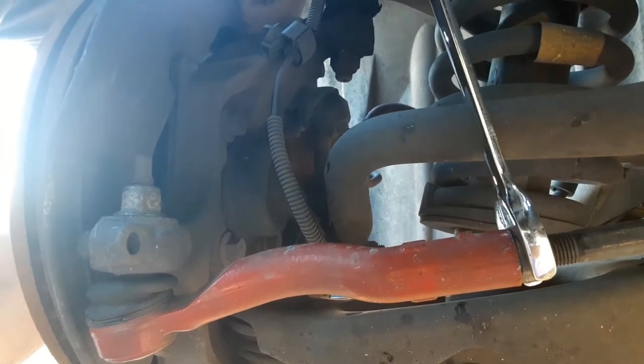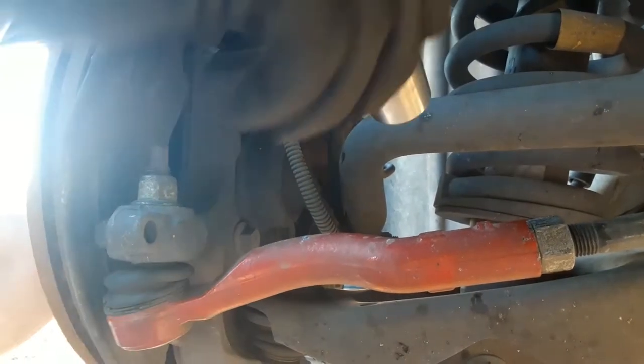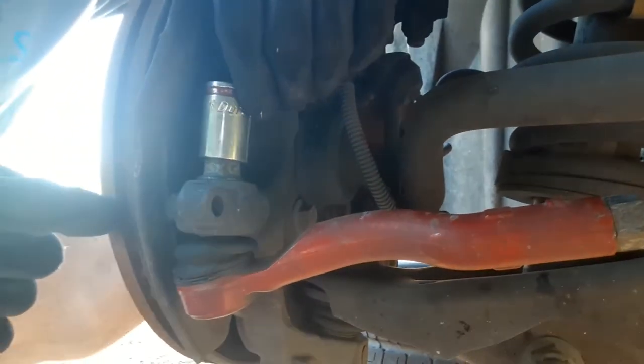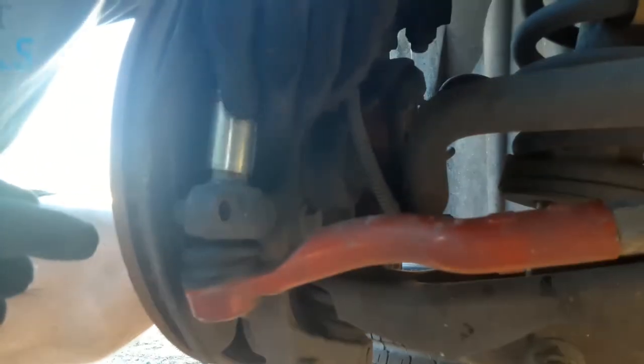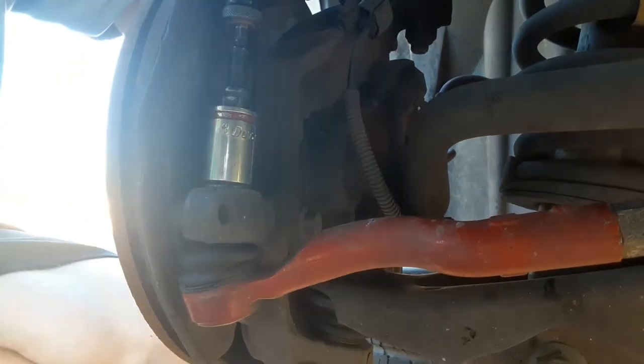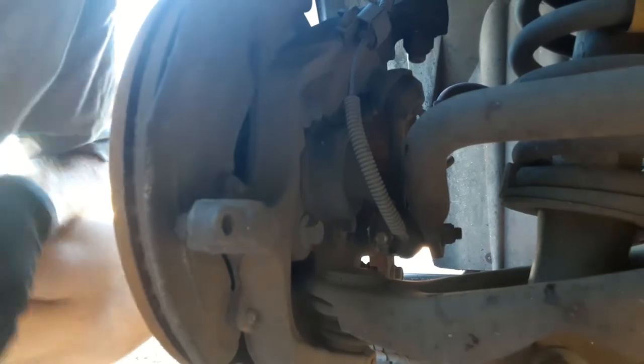You want to just get this loose, break it loose, but keep it where it's at. See, it's moving — just so it's loose — because you're going to have to take that off later. It's hard to do once it's off the car. This is the number 18 socket; it goes on here. I like to use a drill. Stick your drill on there, loosen it up, and it'll come right out. Put your screw back on there so you don't lose it. We're going to do that with the other side.